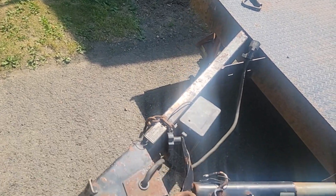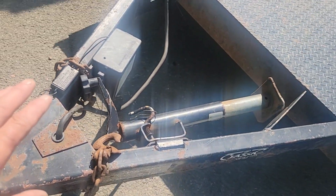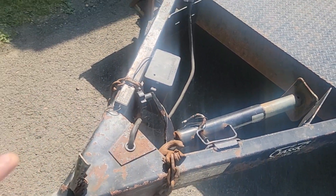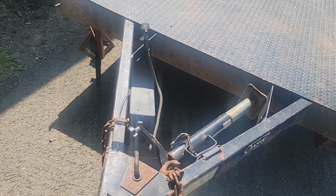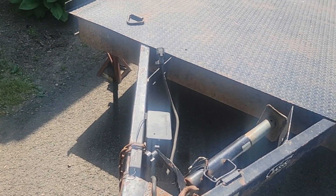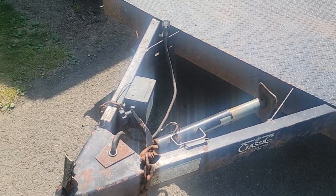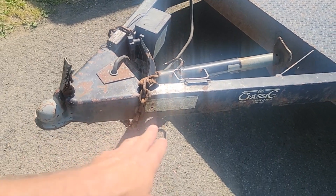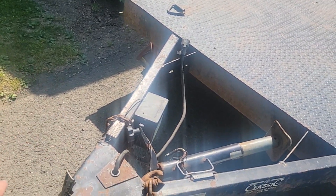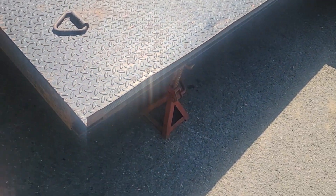A little breeze picked up — it's 88 degrees and pretty hot. I think I'll make this just part one because this is getting long. A lot of people don't know about trailers; a lot do. I'm learning and talking myself through it. I want to make good decisions. You can see the rusted tongue — salt and dirt, stones hammer the front. I want to sand this area and paint it. Underneath I want to paint the frame, probably without fully cleaning it, and inspect for any structural damage.